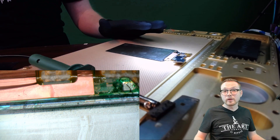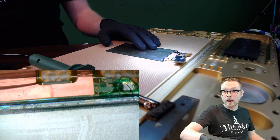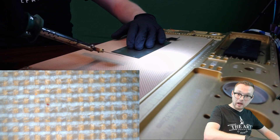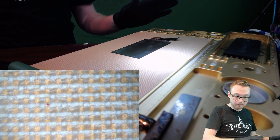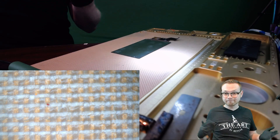All you're going to do — just to recap — start at the corner, get it started, wrap it around, put a little bit of pressure on the display to hold it down, come up at an angle and slowly rock it back and forth. Once you get near the end, stop, pull away, put your tool down, carefully peel it up. That's it.